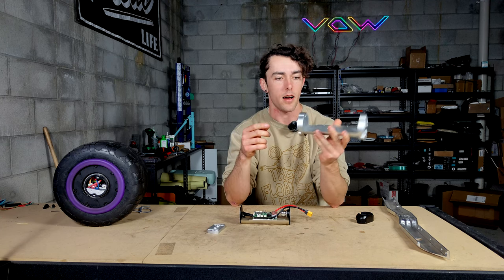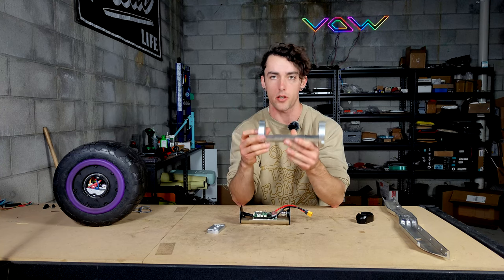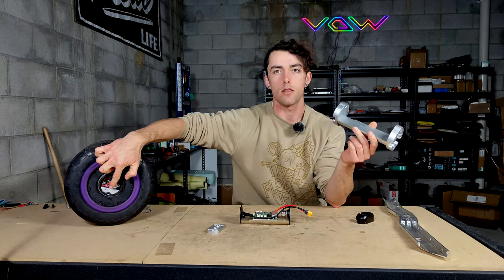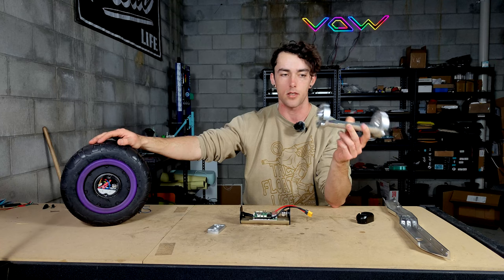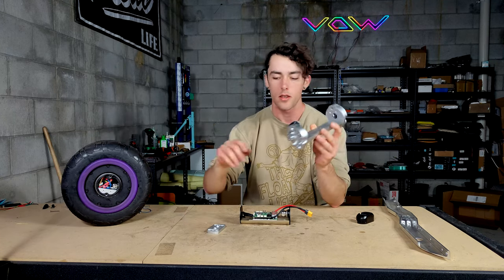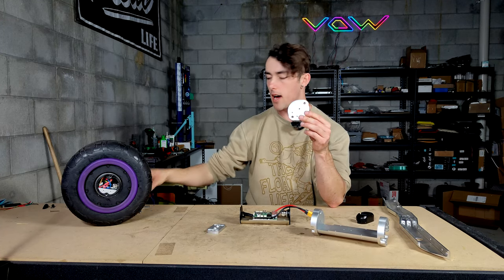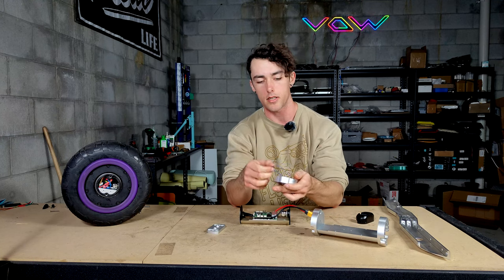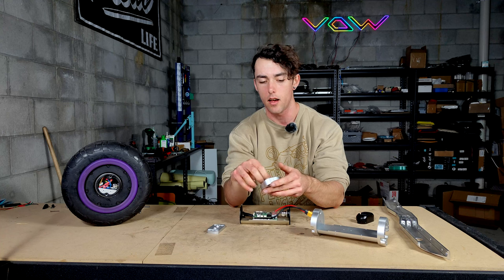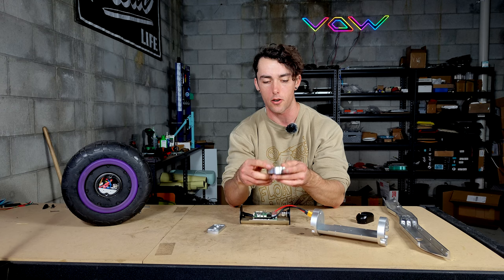These bolt end to end on the cannon core axle and sandwich the block in the middle. This whole contact area is now direct thermal transfer to the hub blocks, which is going to help massively with heat — sending it straight through the axle out to the rails. The V2 hub blocks have channels for gaskets now, so waterproofing is perfect out of the box. You shouldn't need to use the badger kit, though that's still an option.